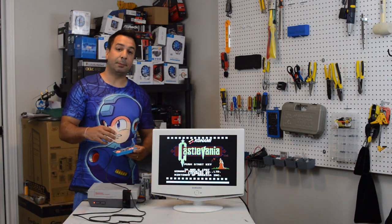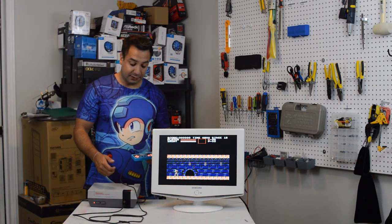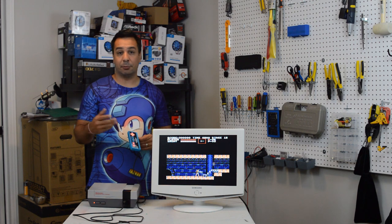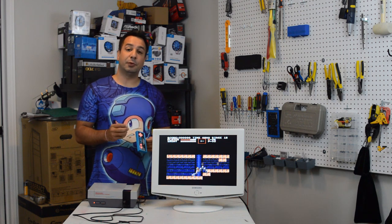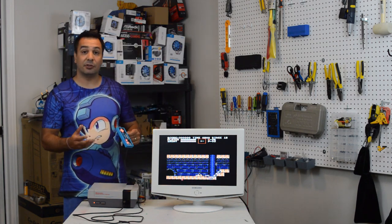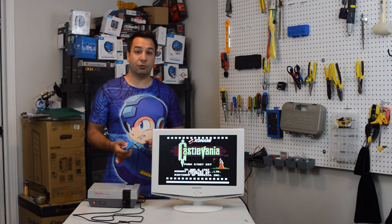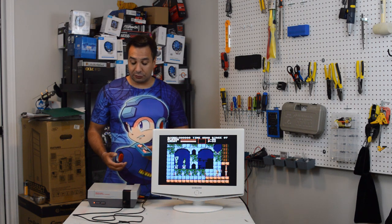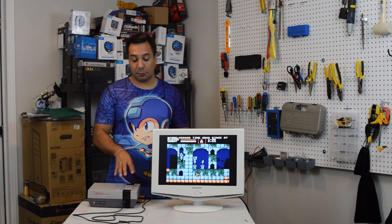By boiling the pins, what we did is we got the pins to tighten up once again, being able to make contact with the game, and basically we have our Nintendo all cleaned up on the inside. There was possibly a secondary problem that we fixed just by cleaning up the residue. But really, that's the first step with a Nintendo before you go any further and start testing components with meters to see if parts are malfunctioning. Give it a good and thorough cleaning like we just went through, and nine times out of ten you're going to have a functional system. When you don't, generally you'll see physical damage or water damage on the board itself, and you'll easily identify which parts aren't working.